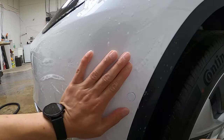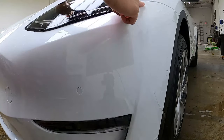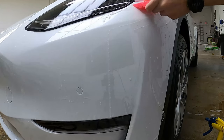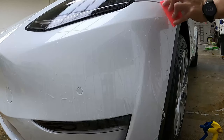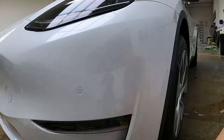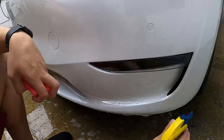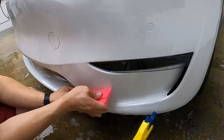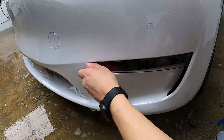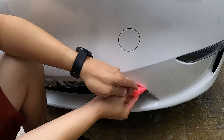Once that is down, we work on the sensor. Our other sensor went slightly out of place so we go back to it and make sure it stays down. We work on the headlight area next — when we respray it, the water drops down to the finished area, so make sure you respray and squeegee that area. The fog light is the next area to align — we pull the PPF down and towards the back of the bumper. For the area under the fog light, same as the other side, we respray the vented area with alcohol and squeegee it down. We then finish off the middle of the bumper, squeegeeing down towards the mouth area, using alcohol to help hold it in place.